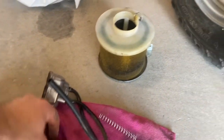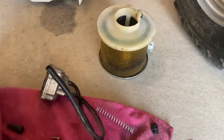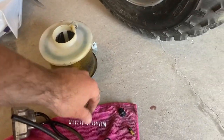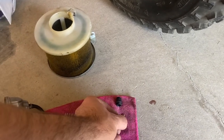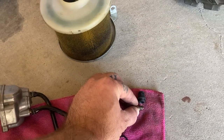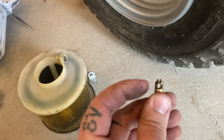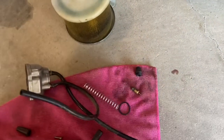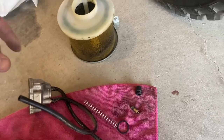On this choke here, I was going to show you guys the easiest way I've found to put this all together. So you've got this piece here and somewhere there's a spring — it may have shot off. There's a spring that goes in between here. If you shove this up on, shove your spring up on, you can actually lay this sideways just like this and press it up on. Get your little end of your cable inside here and then you can turn this back and it'll pop right in place. They're pretty simple. It's just kind of hard to hold the camera and do all that with just me here today.